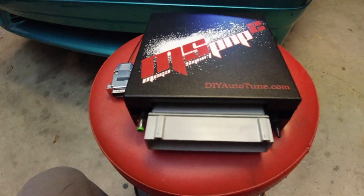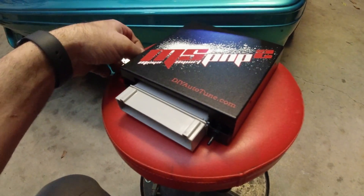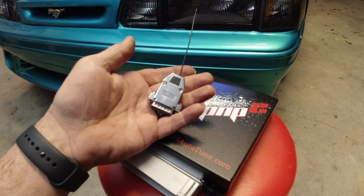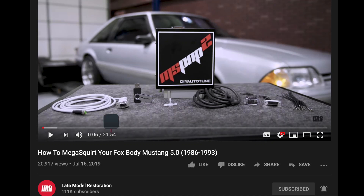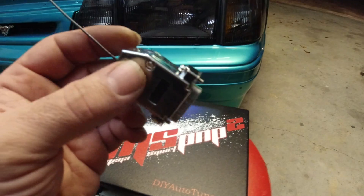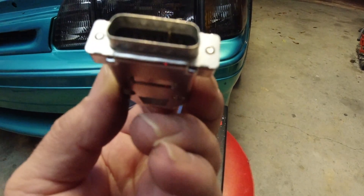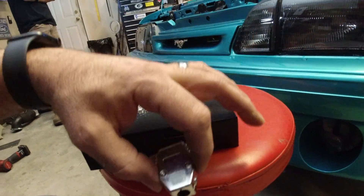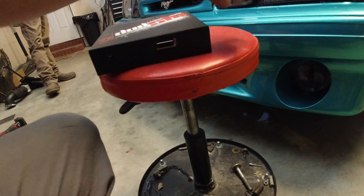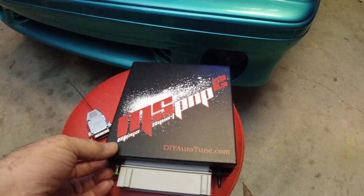This is the Mega Squirt, not the Micro Squirt, so there are a few things you have to do with the car. We will be reading off of the air fuel gauge off the wideband. With that you need to pin this out. LMR has a really good video — go check out LMR's video on how to pin everything out. It comes with a pack of pins and a pigtail, and all you're going to do is pin the number 21 port. That way when you plug it into the back, port 21 has a pin on it, and that is what you're going to tie into your AFR gauge.